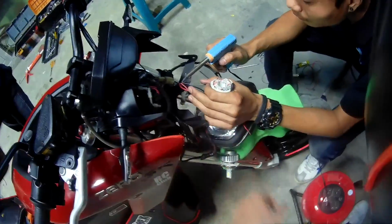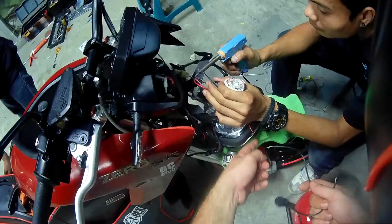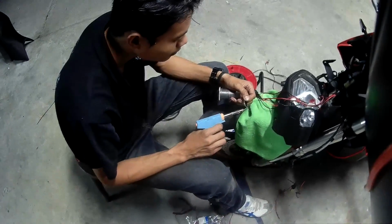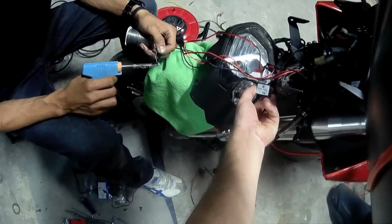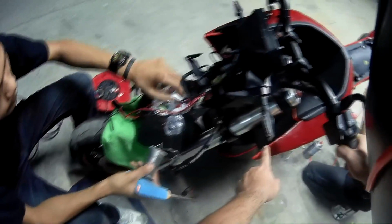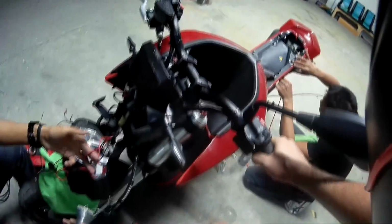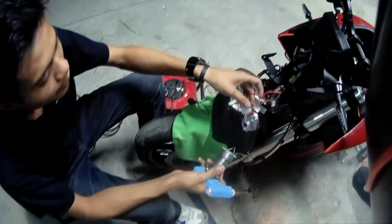He's gonna solder them together, and then we attach this to the solder unit, to the fuse. We are soldering the last connections of the 12 volt parts for each EL wire. Basically, I'm using 2 EL wires, each 5 meters long. So we use the right side 5 meters, now we use another left side 5 meters, and we use this 12 volt fuse.